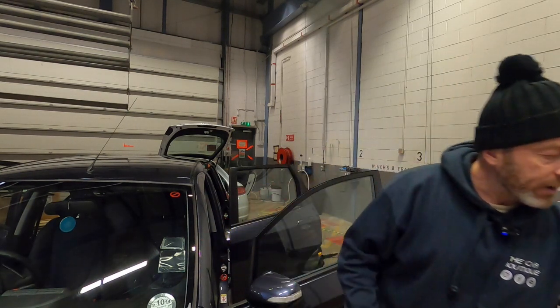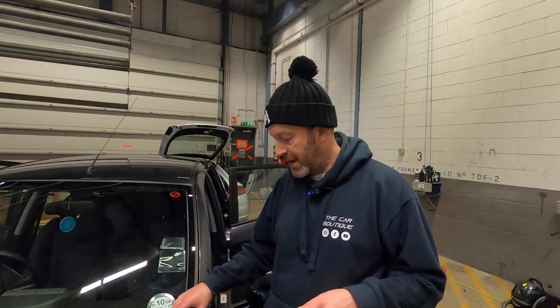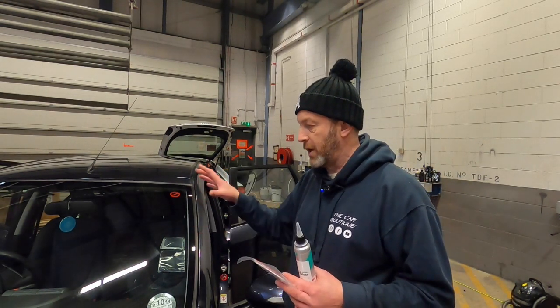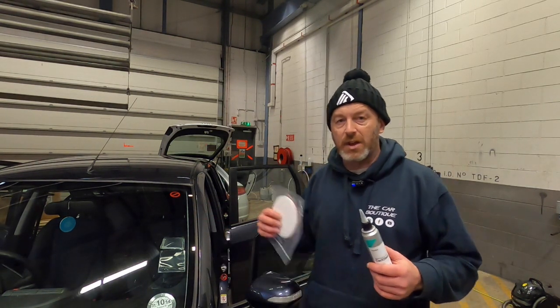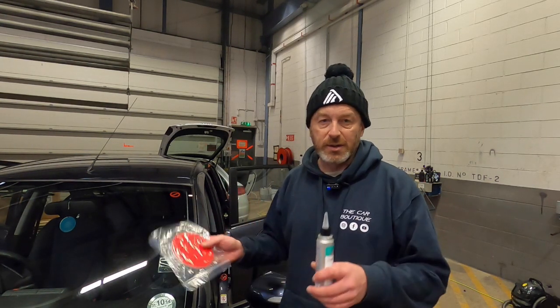for applying your glass cleaner. What I did notice is there are some wiper scratches and some little scratches, so I'm not gonna do it this time, but I'm gonna ask for this back sometime in the future. I'm gonna hit it with some Ceri Glass, which is a cerium oxide based product, and a rayon pad as well. And I'll probably do a tutorial on glass cleaning. So we're gonna try and get rid of all the very, very fine scratches on this windscreen. I've done it before, with a reasonably good degree of success. You're not gonna remove deep scratches, but just those wiper arm marks that seem to stay there. These two should do a good trick, so that's something for the future.